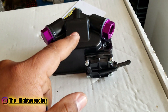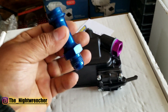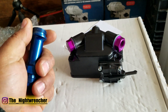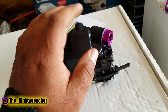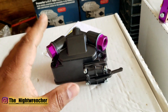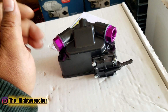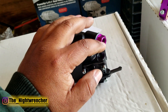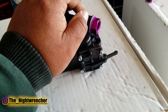The factory fitting installed on these carburetors is set up for a 5/8-inch inverted flare fitting, but you can pull that off and install a set of AN-style fittings — this particular one is a Dash 8 feed line, and you can also get them in Dash 6 or other variations. I don't necessarily like the inverted flare; they tend to leak a little bit, especially on cheaper fuel rails. I'd much rather run AN-style fuel rails, just because I'd prefer my engine not catch on fire. But because most fuel rails on the market are inverted flare, they used the universal thread pitch so you can upgrade if you want to.